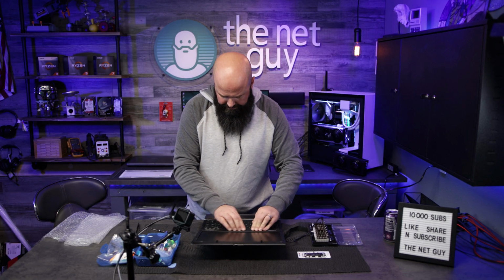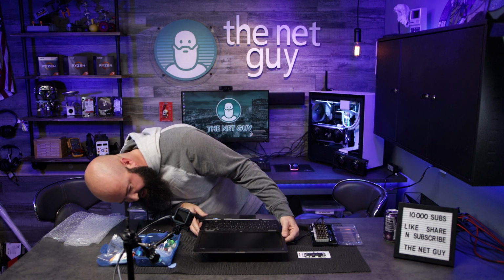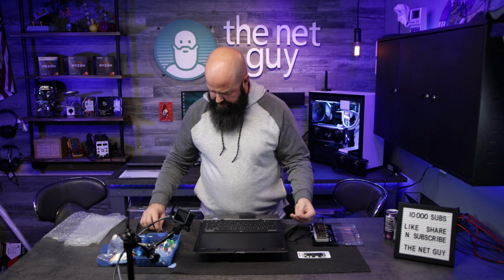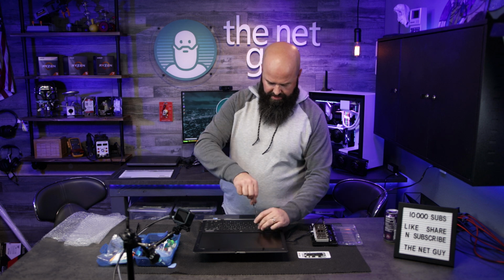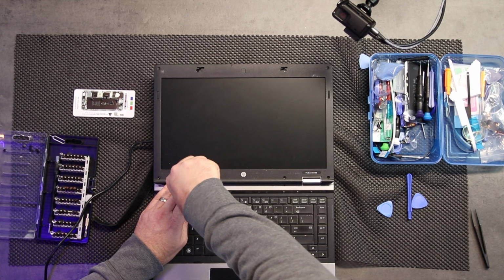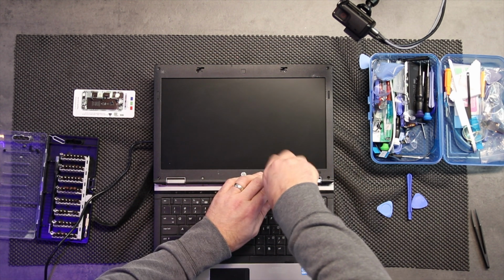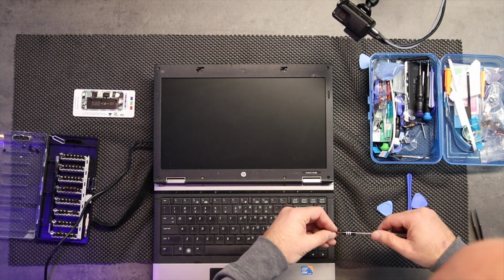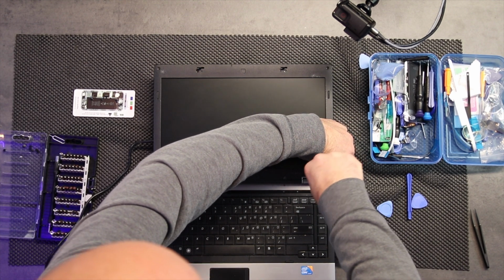Okay. I'm just looking for any seams or gaps that may not be all the way down. And now I'm just going to put back those 8 screws around the outside, and hopefully there's enough adhesive here. I'm going to work my way from inside out, kind of like you rotate around a car when you're replacing a car tire. Just want to have even tension, so I'm going to work my way up and make sure everything's clipped down all the way, especially those hinges.